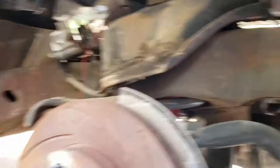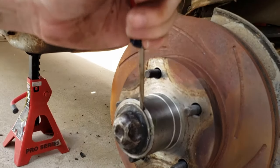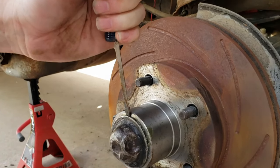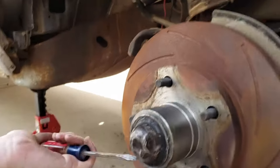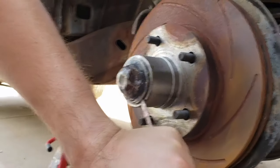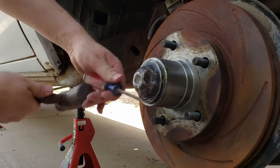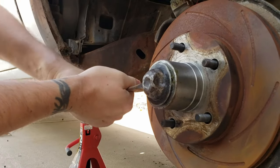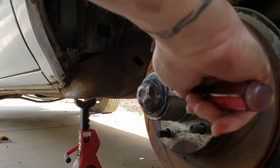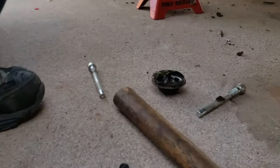Unfortunately this doesn't just slide off, and that's what Liam's going to do next - that's why I got the flathead screwdriver and hammer out here. For those of you that have never done this before, you first remove your dust cap - this is a learning episode. You use a very very thin flathead screwdriver, or make one using a grinder, and you go all the way around it kind of like you would a paint can to pop it out.